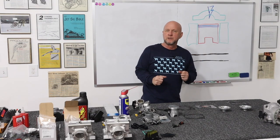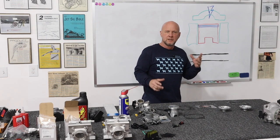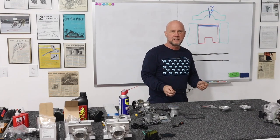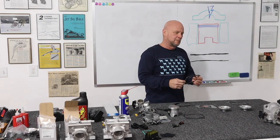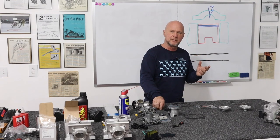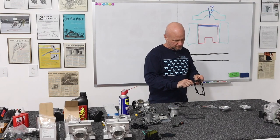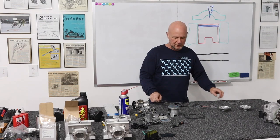Obviously the heat's going to be under control — getting rid of the coolant tube with the thermostat, lowering this. These were all runs on 92 octane Shell V-Power gas and my oil at 51 to 1. Keep all that in mind. It was also based on a 45 thousands base gasket stack. I have a gasket kit that comes with the bike — there are two gaskets in there. I mark the two, write 300 on the ones you should stack together to get your proper squish band height, which gives you 2.3 millimeters of squish band clearance as called out in the manual — basically 90 thousands of an inch. One's a rubber-coated gasket at 26 thousands, and then you've got the other at 11 to 12 thousands depending on how you measure it.